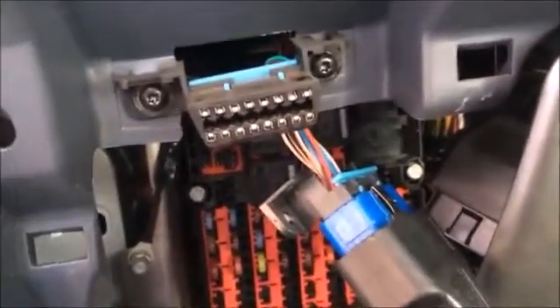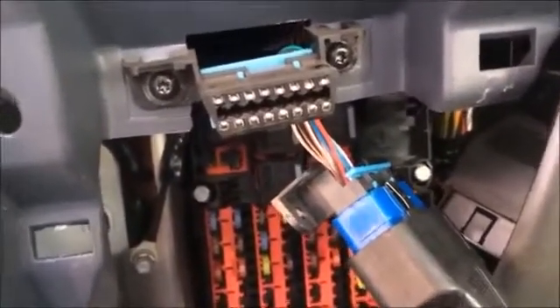I'm in a 2013 Transit Connect. As you can see, all the pins are occupied on that port right there — that's a fake port. The real port was actually behind it. It's plugged into a GPS unit up above. You'll get power if you plug into here, but it won't program; it'll just communication fail.